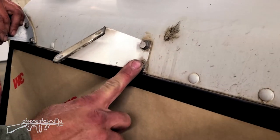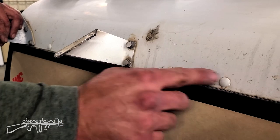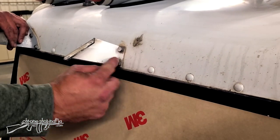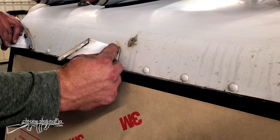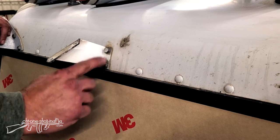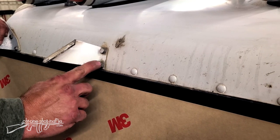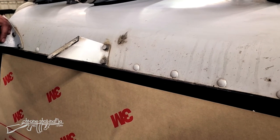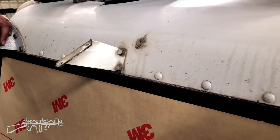On this truck they are 3/8 bolt heads. Typically they use huck fasteners like what this roof cap is attached with — they'll just have a little domed head that we have to grind off and then drill the head off of it, and we'll need to put inserts in there. In this case, these bolts have already got threaded inserts of some kind in there, or it's possibly just threaded right into the roof cap by itself. We'll pull these off and see what we have to work with.